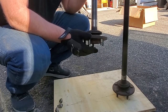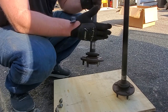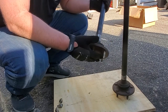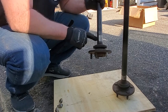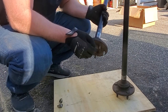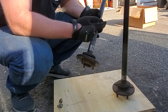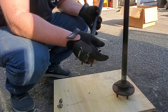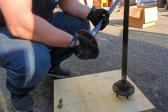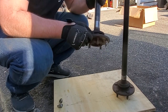All right, guys, time to talk about the axles. Now, this axle shaft is from this ZJ with the Dana 35. You're gonna wanna keep these axles because you're gonna need this tone ring to retain the ABS. Now, if you don't wanna use the ABS, don't worry about it. If you have a Chrysler 8 1/4, reuse your Chrysler 8 1/4 axles, but I really wanna use these axle shafts. I don't think I'll be able to because I'm gonna wanna tow this thing out of my house.